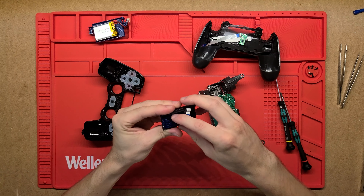That PCB doesn't actually come out — my best guess is it's glued to that piece of plastic. It's a matrix of signals in there, and as you touch it with your finger it's probably got a capacitive detector that reads the signal. This little IC would process it and then send out a digital signal. It's got ground, power, and three comms protocols, so it does a lot of processing on board and then just sends a digital signal out to the mainboard.